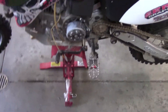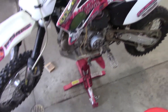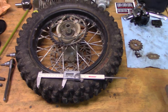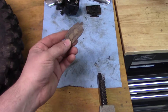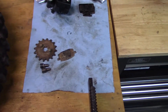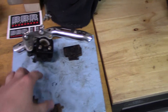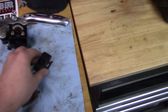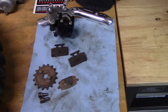I already started taking apart a little bit. Here's where I'm at with the Piranha: I've got the rear wheel removed. The brakes are totally shot — this was the back brake, the guy told me they were fine, but there's nothing there, no pad. The front brake caliper seems okay; I cleaned it up, wire-wheeled it, oiled and lubed it. Those are the pads off that. I need all new brake pads.